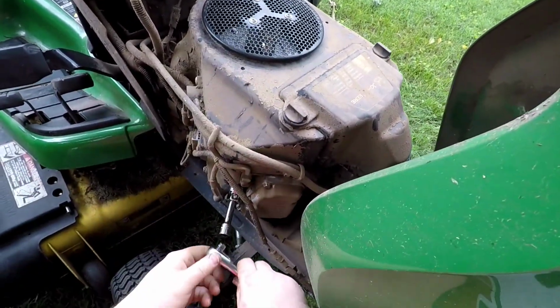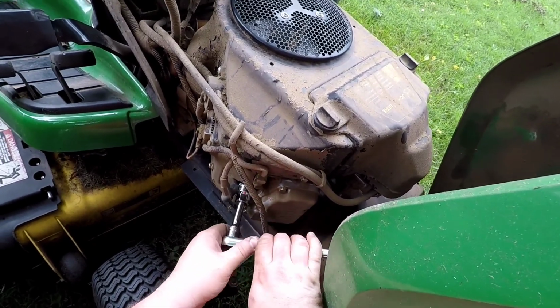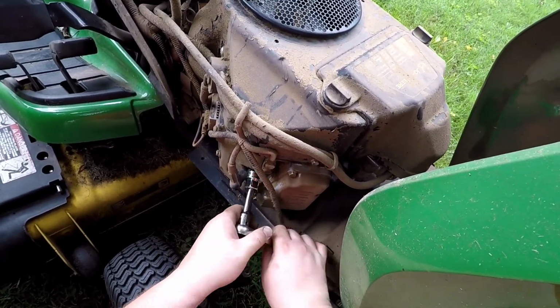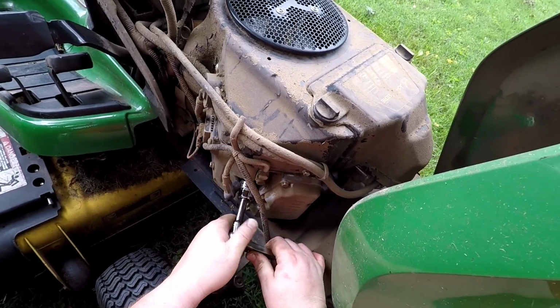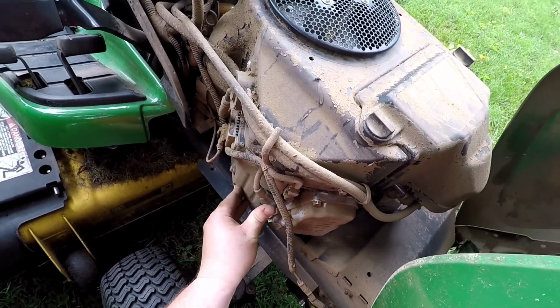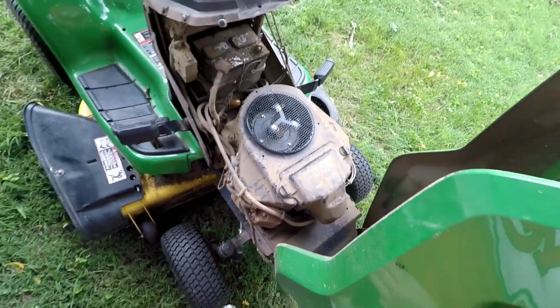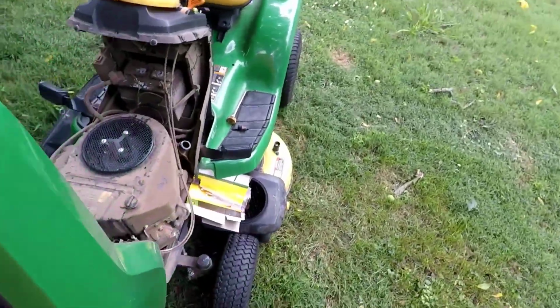Okay, more hand tight. Pop that on there. Seat that crush washer. There it goes. And then just a little extra, maybe about a quarter turn. Snap that on. Don't know if you guys could hear that. You can feel the snap. And then let's pop back over.